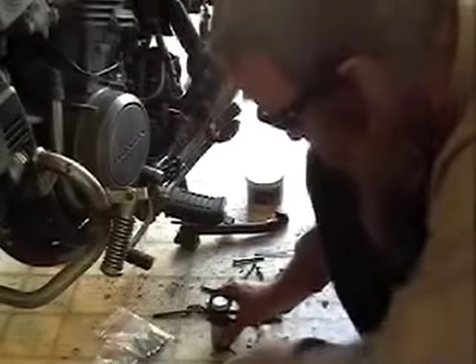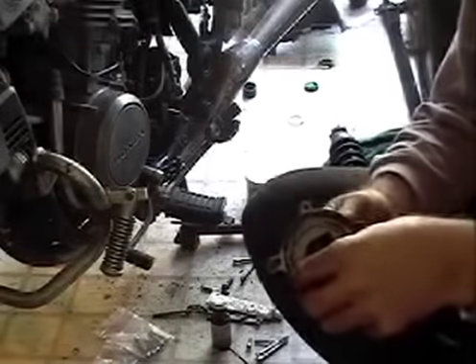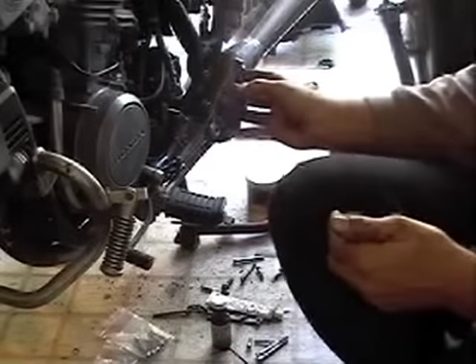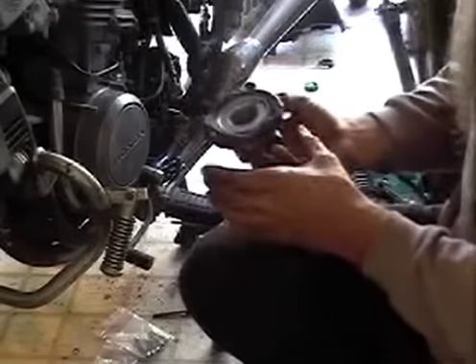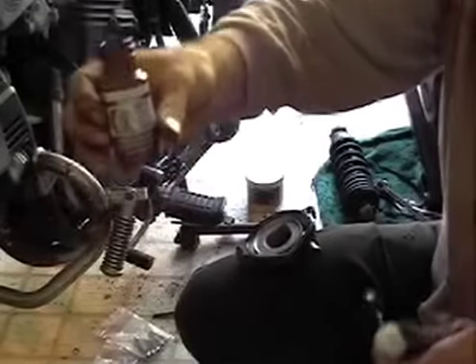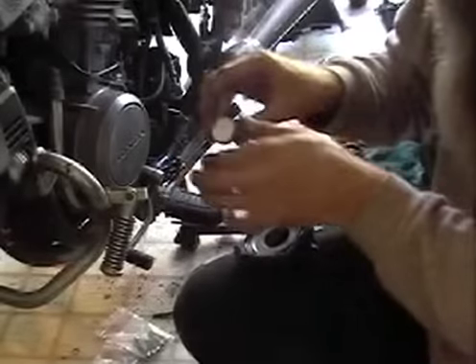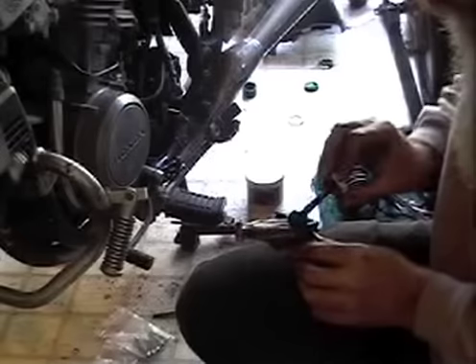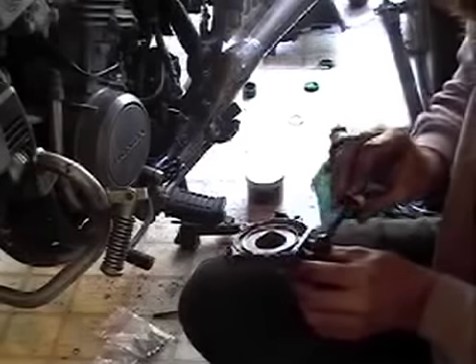Now, when you get to this part right here where you're putting the water pump on and you've got this stupid little O-ring that falls out readily — when you go to put that sucker on, nine times out of ten it's gonna fall out on you. My secret is I take Indian Head Gasket Shellac. It ain't the best stuff you can buy, but for general utility just making stuff stick, it's wonderful. It ain't gonna hurt nothing — you just brush it on just a tiny bit. All you're trying to do is make sure that when you go to put this sucker on, that O-ring ain't coming out of there so that you don't pinch it and your water pump don't leak.